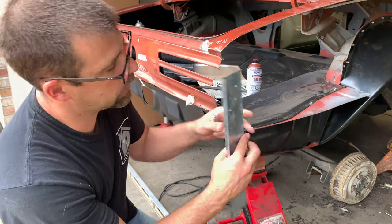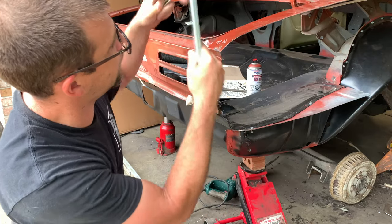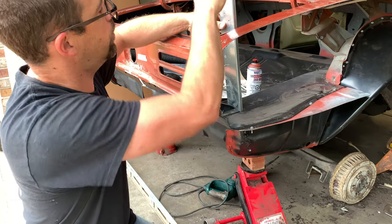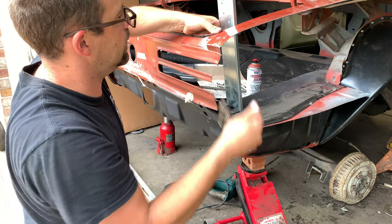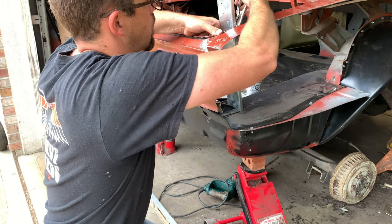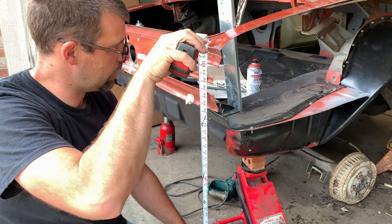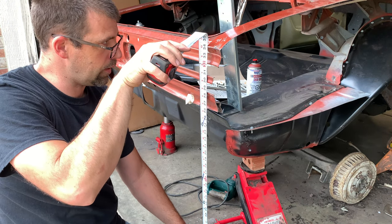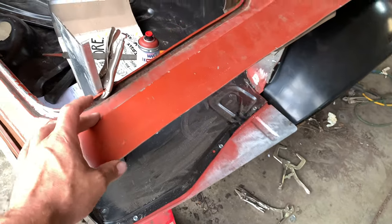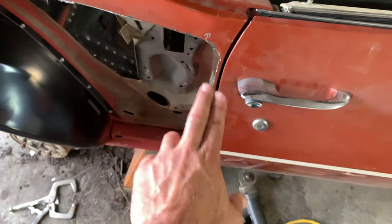Here's how I plan to adjust it — pretty simple. A chunk of scrap with a little angle on the side — actually the piece I used for the plug weld video. I'll throw this up inside here, clamp it to the gutter, hold it in place, and hopefully get the dimension right. Good news is it's fully adjustable. And there we go — 34 and a sixteenth. Our prep work is set: trunk floor is at the right height, quarter panel trunk jam opening is at the correct height, our body line tape reference is on the door, and the door gap looks phenomenal.